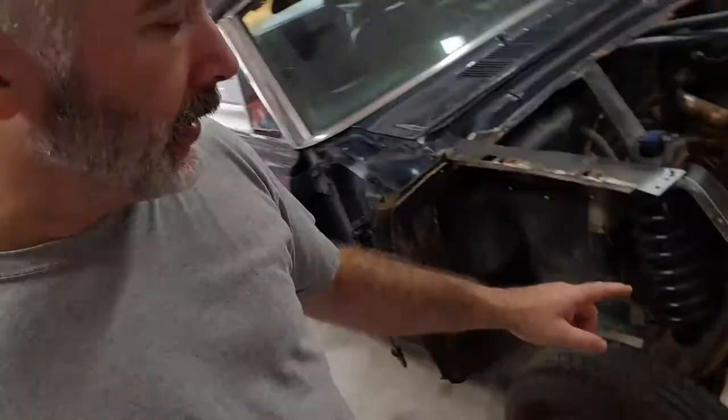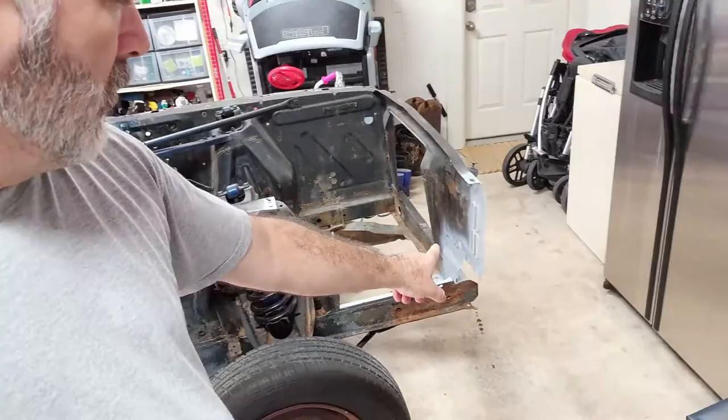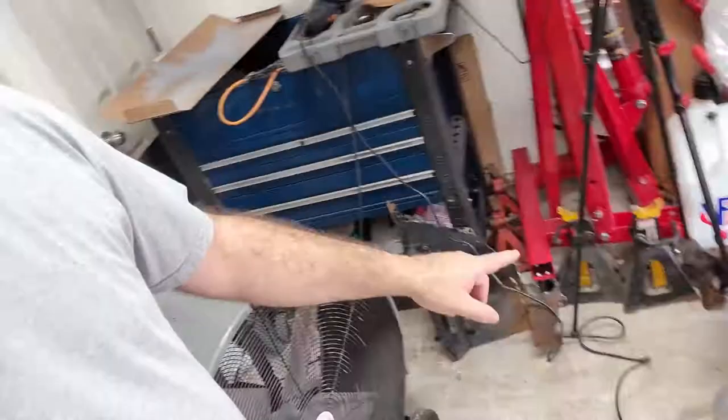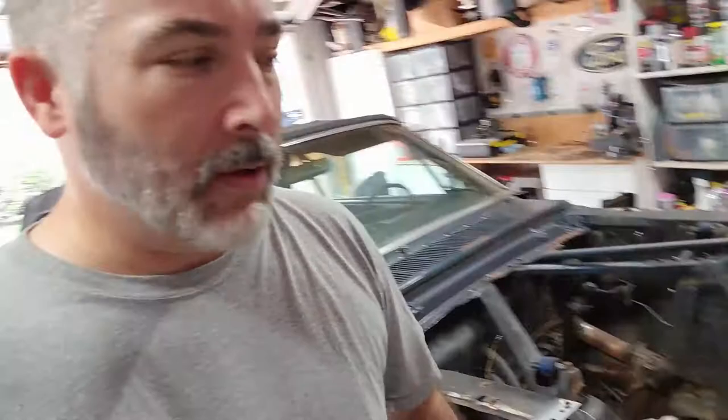The other thing is, I've watched a couple of different YouTube videos on what to do here, and there's a ton of different ways to do it. But I think what I'm going to do is actually drill out the shock tower and the frame rail, so that way the inside of this, when you're looking at it from the fender well, it looks like a genuine spot weld. And then inside here I can just grind my welds down and you won't really see them because it'll be in the fender. That's the plan at this point.